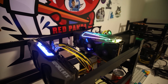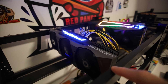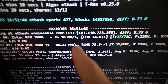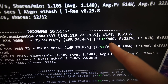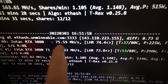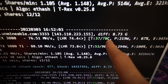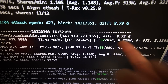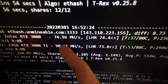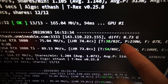I'm really happy I've been changing thermal pads recently. My Zotac 3080 non-LHR is on the bench too, and this one here is actually the LHR 3080 Trinity. Zotac's LHR GPUs run pretty cool, though partly because we're not mining at full 100% unlock — it's LHR at 74.4, getting about 75-76 megahash. We could try dual mining to see if temperatures go higher, though it wouldn't be using 100% of the GPU memory anyway.